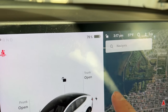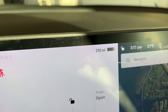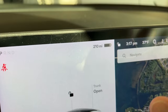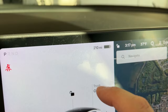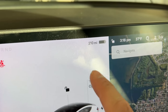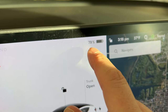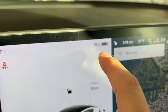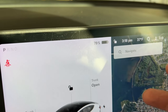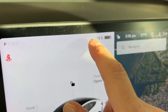Another trick to check your battery range: right now I'm at 79%, but if I want to see how many miles that estimates, just tap on it — that's equaling 210 miles left on this charge. This isn't a sign of battery degradation. The computer analyzes your driving style along with your environment, temperature, and the tires you have on — everything is taken into consideration. This has very little to do with actual battery degradation. If I charged to 100%, it won't say 310 miles like when the car was brand new; it'll calculate based on how fast I normally drive and what accessories are usually on.